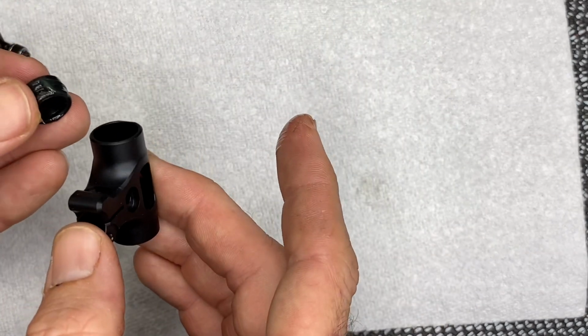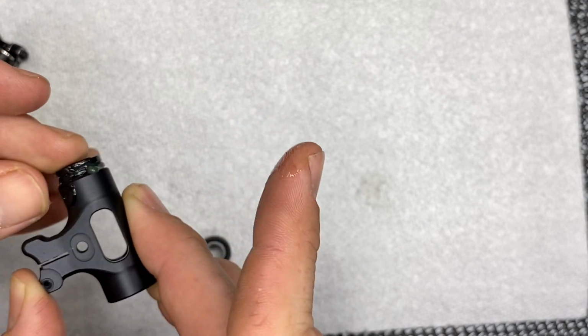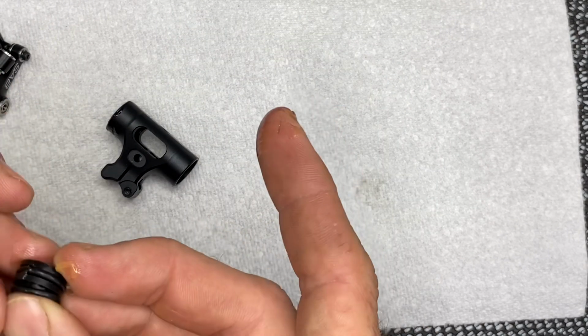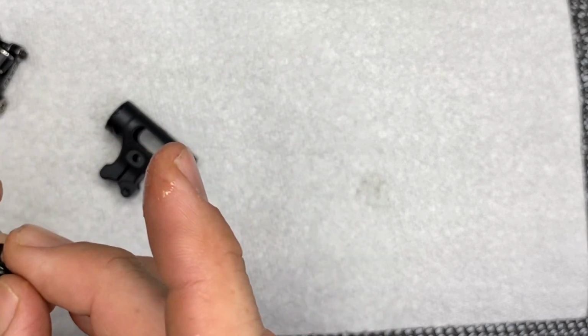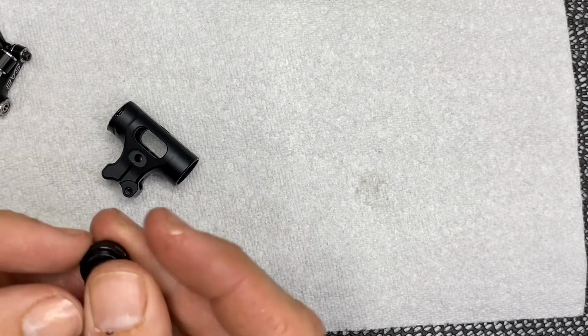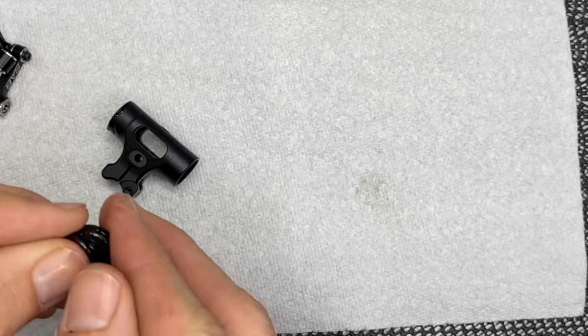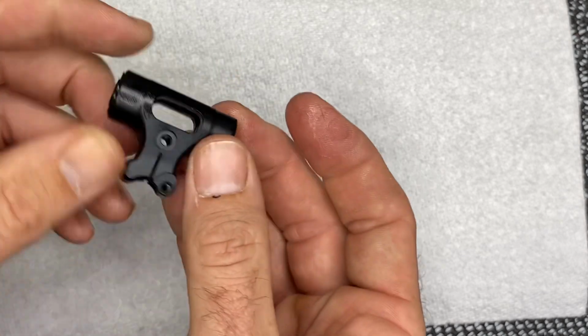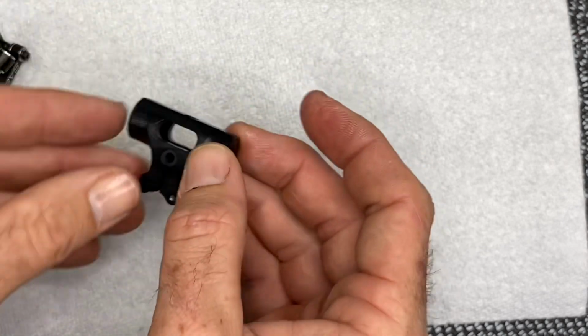We're gonna take our head block, and we're just going to push this assembly all the way down. Wipe off the excess, take this one, same thing. Get some micro lube around all of our O-rings. And then we're gonna take this assembly, and this one O-ring doesn't want to stay all the way on. We're going to slide this assembly down. So now our dampeners are installed.